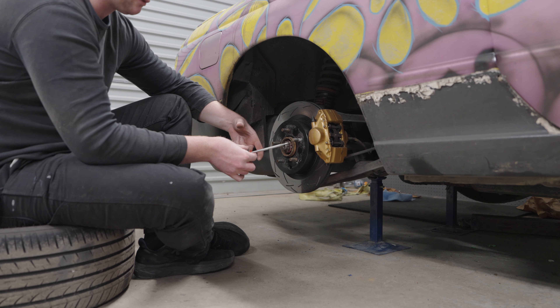Holy - how loose is this thing! Is that maxed out? Just doing the handbrake in the 32. I can't tell you for certain which way you've got to spin the spindle because you might have put it on backwards - everyone does. So literally just adjust it until you can't move the wheel anymore, then back it off like two clicks. If it moves freely again, leave it there. If you go back up one click and it binds, that's where you stop - go back off that one click. You just want it to just not bind.